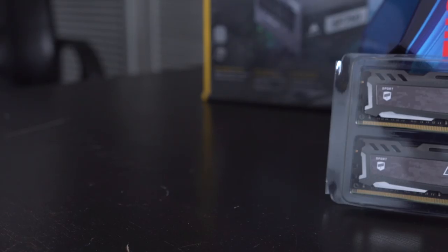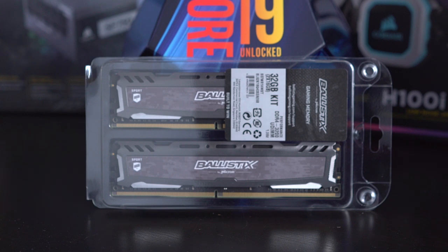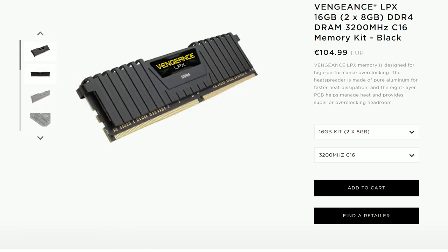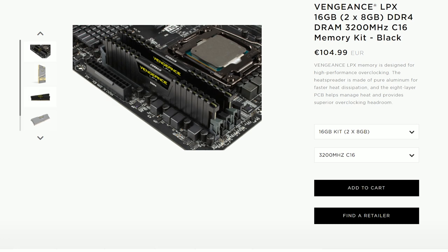For RAM, I wanted to go low profile to leave as much space for other components as possible. The obvious choice was the Corsair LPX low-profile sticks. I'd seen good sales where 32GB could have been about £130-135, but by the time I was buying it was hovering around the £160 mark. I decided to go for the 3200MHz CL16 timing - based on my research that was a sweet spot, and going higher like 3600-4000 would be diminishing returns at too high a cost.